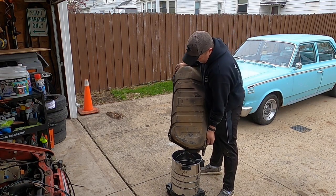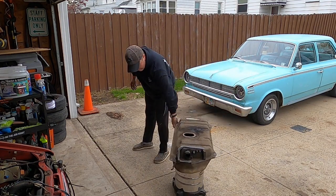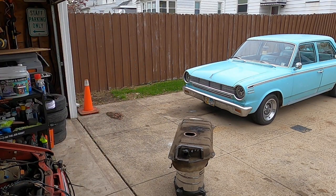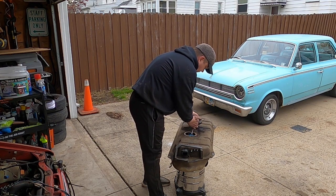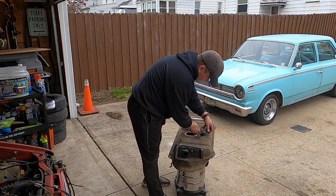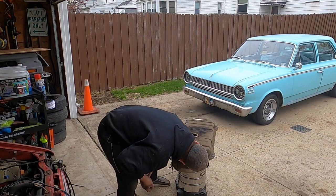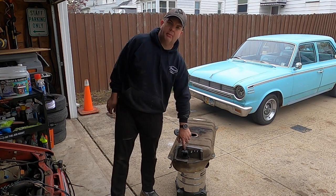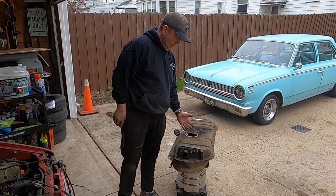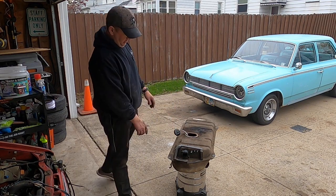There's something in there, it's just not coming out. I'm going to shine a light in here and see if you guys can see it through the other side. You would think you'd see a light through there, right? Nope — oh no. I see the issue. This tube that the filler neck attaches to — it doesn't stop right at the front part of the tank, it extends into the tank. So when I'm pouring, there's not enough in there to flow into the tube and out into my container.